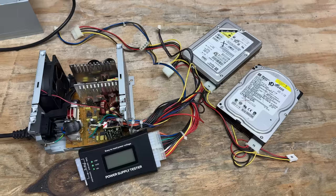Drive removal on these systems is kind of strange - this entire center section is supposed to come out, and all that transparent plastic on the drives come out as one unit. That could prove quite nerve-wracking because this thing's already got some broken plastic pieces floating around. You pull on a release tab and then push the entire drive cage forward. Apparently there was a lot more broken plastic than I realized - this thing was being held together by hopes and dreams.